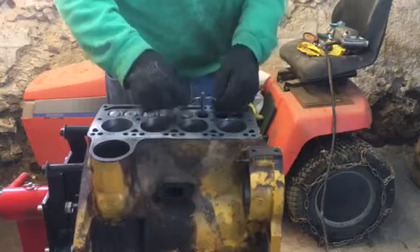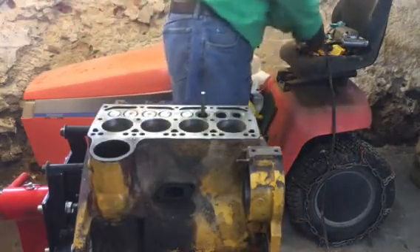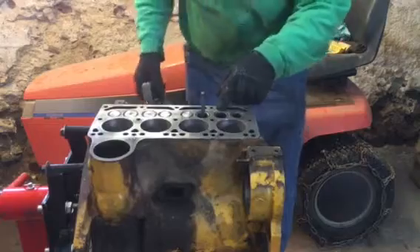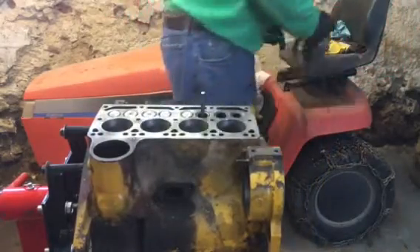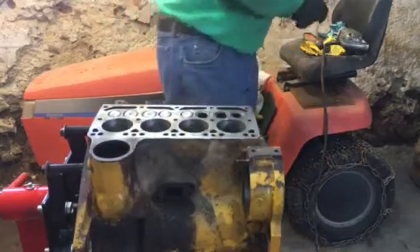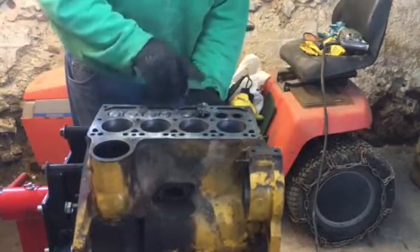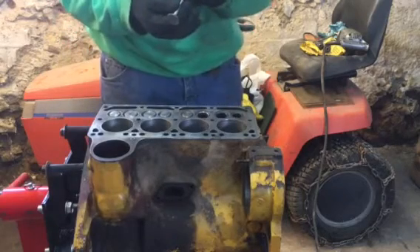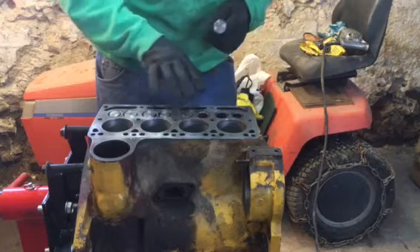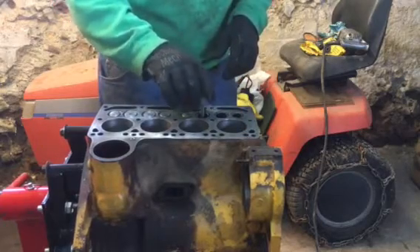I'll do the number two intake seat. This won't take much at all because the intake seat really looks pretty decent. I'll just give it a really light hit with the stone just to make sure everything's all true there. Now that looks pretty good. I'll pull the pilot out, get my new intake valve, tap that on the seat a few times and see where it's contacting. And again that looks pretty good — that's just about in the middle. If I wanted to be really fussy I'd tap it just a little bit with a 30 degree stone, but it's pretty good so I'm not going to mess with it.